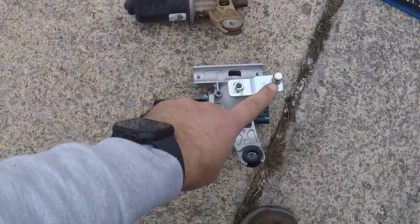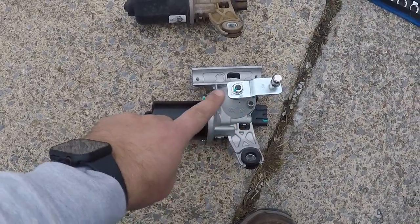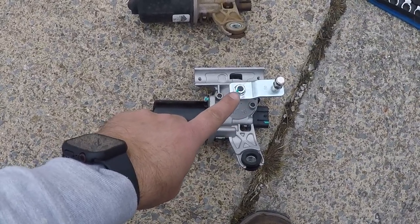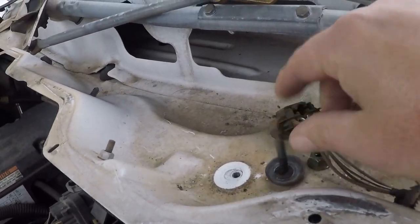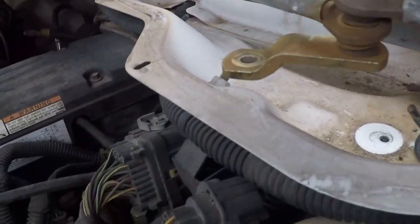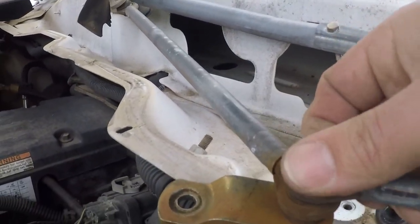Looks like I'm going to take the wiper arms loose and try to put them over this spindle instead of disconnecting the arm, because it's splined and this is in its resting position, so I want to install it this way. What I had to do was deal with a 10 millimeter bolt here and then two 10 millimeters at the top — that's what I'm trying to get off right here. Going to inspect this and see if we can get it off.